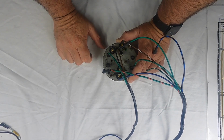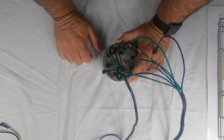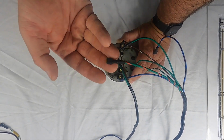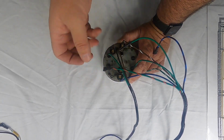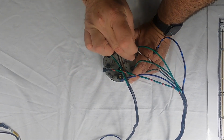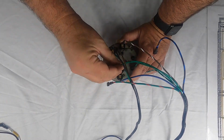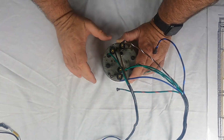A lot of people say they put it in there early for the Sportomatic transmission that was going to come out in 1968. I don't think that's the case. I think it was added for the 912. They just didn't update the wiring diagrams. So, but you could use this. You're just going to have to figure out how to get it over the fan shroud and up to the sending unit, or you can use the green that's already there. So I'm going to use the green. So let's connect it to that bulb right there. We'll get that out of the way.